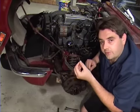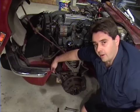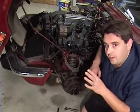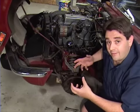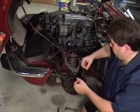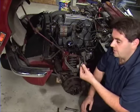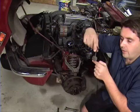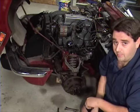The first thing you want to do is take apart the linkage that holds the lower wishbone to the roll bar — the roll bar is this bar right here, and your lower wishbone is the bottom of the suspension. Depending on what type of setup you have, they're going to be a little bit different. Mine is an aftermarket setup bolted directly with a clamp system to the wishbone. Most of your cars are going to have a little linkage system where it's bolted into the lower wishbone with a stud that goes right into the end of that anti-sway bar. Either one you have, you're going to want to disassemble it first.